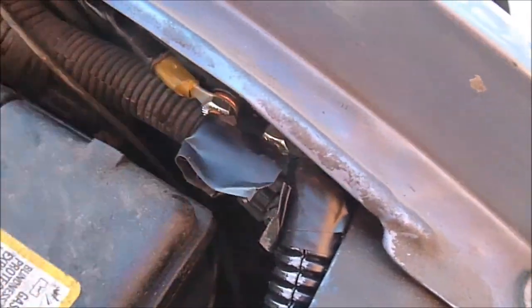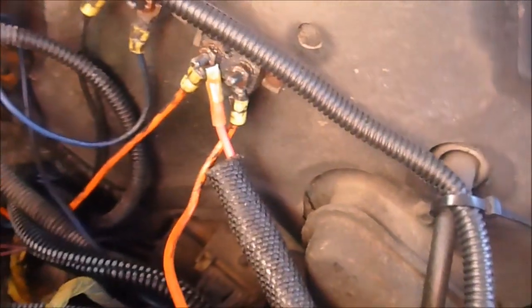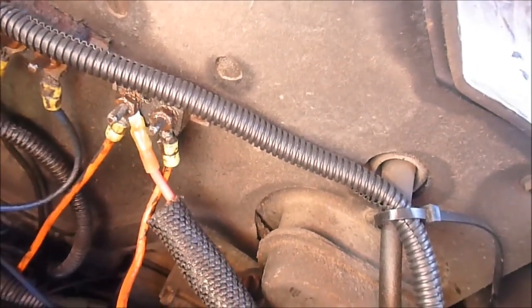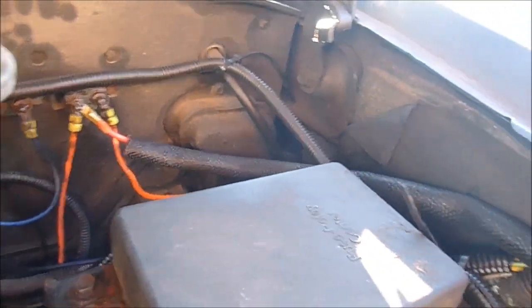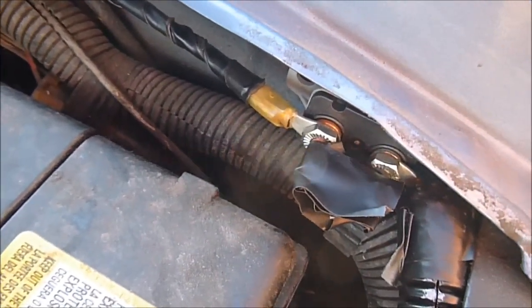Again, this will be fastened in — it's just got tape over it right now to protect it. But this circuit breaker is actually protected further down the line where it picks up power by another circuit breaker down there. Whenever you're doing wiring, you can't be too safe, because if you don't use protection against short circuits, a little project could end up being a disaster — it'll cost you a whole vehicle. So always protect with circuit breakers or fuses. I like to use circuit breakers on headlight circuits because if something goes wrong, they'll flick off and on, and at least you'll have enough light to get to the side of the road safely. Let's get everything buttoned up and we'll start her up and show you how it worked out.